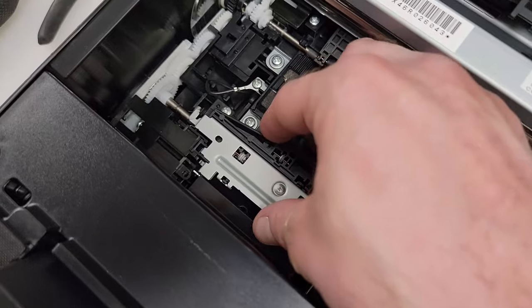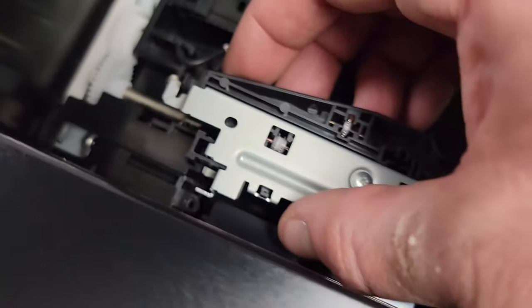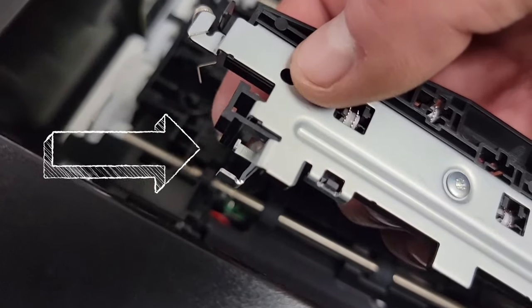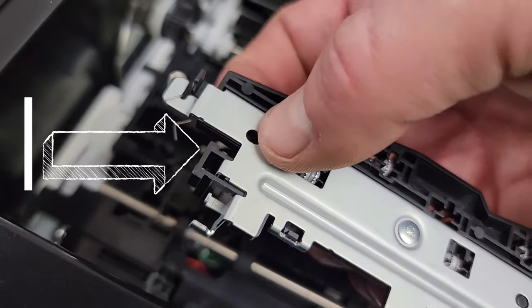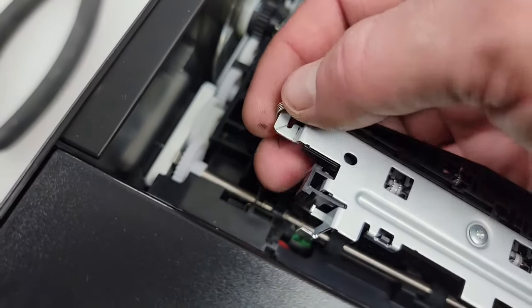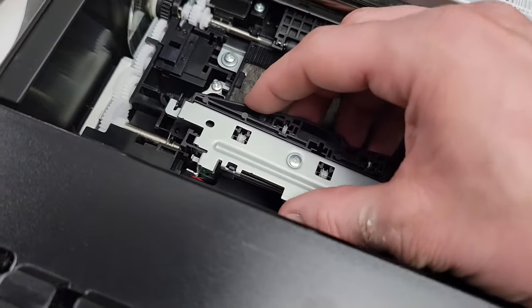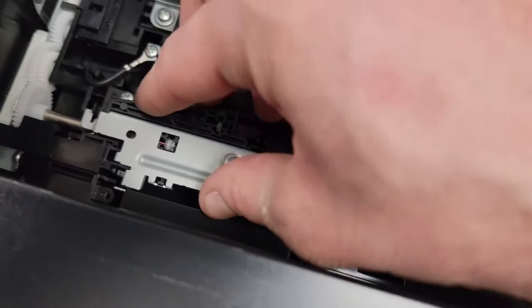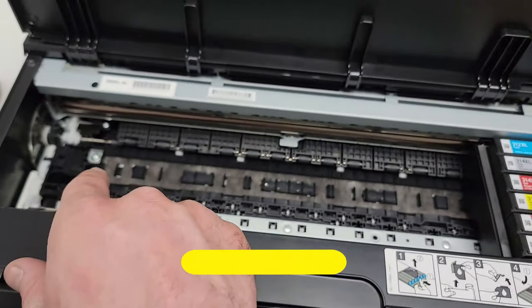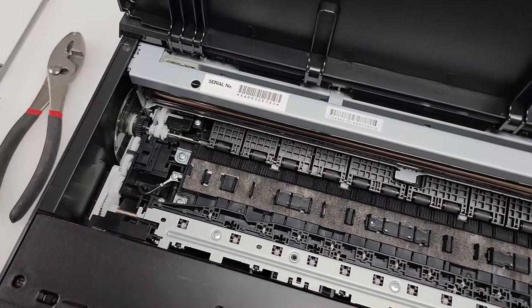Now you can see I can lift it up, and the only thing holding it down is that little piece of metal, which just popped right out, so now this is free to come up. You'll also notice there's this little black tab here — we're going to need to break that off and bend this piece of metal so that it straightens out, and you'll see why in a moment. I'll grab this spring off of here. Next, just realign the bar and make sure it goes back into place, nice and flat, because we need to move the printhead over to the left side.